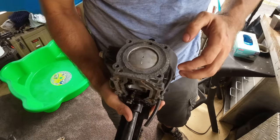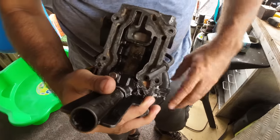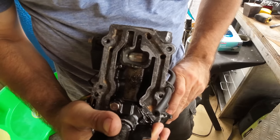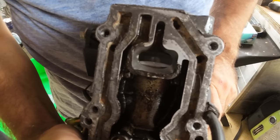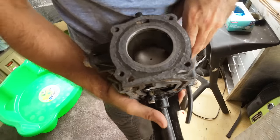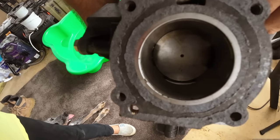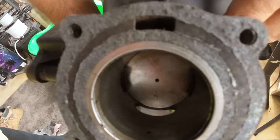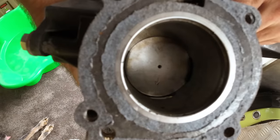That's the top of your piston. You see it's burning quite clean because there's no carbon and rubbish on it. This is the exhaust port. So as you bring the piston down, you can clearly see into the bore. But then if you look down here, you've got a hole there and a hole on that side, and that's the intake ports. So they're different heights in the cylinder, that's basically the equivalent of valve timing on a two-stroke.